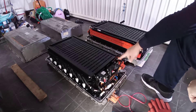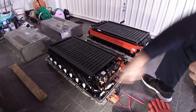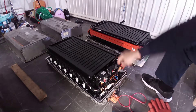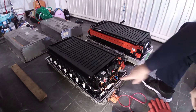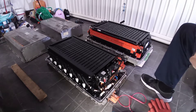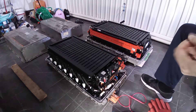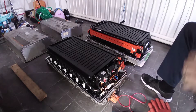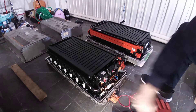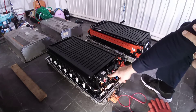The charging system goes through here and then all the way back to the charging plug — this is the positive pole. Right here we have a crossroad: we have a big fuse that goes to the big power relay, which also has a 12 volt coil, but this one I never saw broken so I think they are pretty reliable. There's a little relay right here that has to do with the 12 volt circuit, like this fuse right here. You have a little fuse right here, but in reality it's a diode — you will also check this when you have problems.